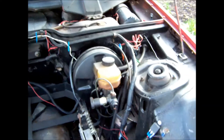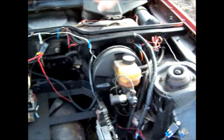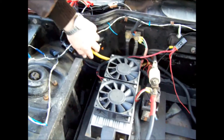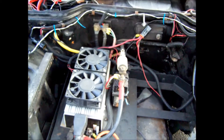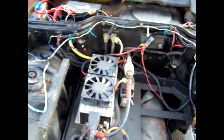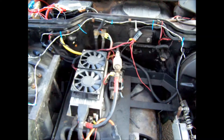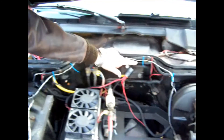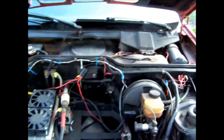The main DC-to-DC converter is in the center console — it's easy to get to. That's the yellow cord there. The yellow cord goes under the dash and it looks like an electrical receptacle, and the DC-to-DC converter is just plugged into it. So that's easily removed if anything ever went wrong with that. There are some big fuses here, fuses here, fuses here, fuses here, and one fuse there. I put LED taillights in.